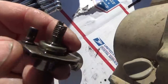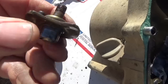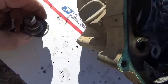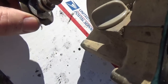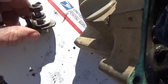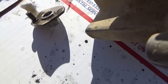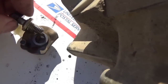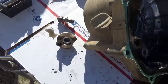I took the clutch adjuster out and you can see how it's boogered up. The real problem is this is threaded into here, so as you turn the piece with the screwdriver it kind of takes up the play. This is the one I bought, and for some reason they have a galvanized washer on there - that just doesn't belong there. You can see how as you unscrew this you would take up the play. You can see down in there there's that little O-ring - you kind of need that to make the oil seal.